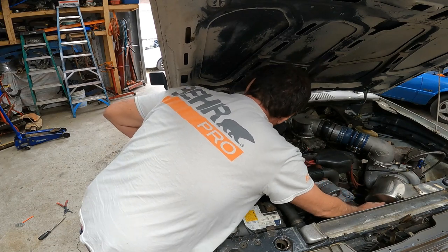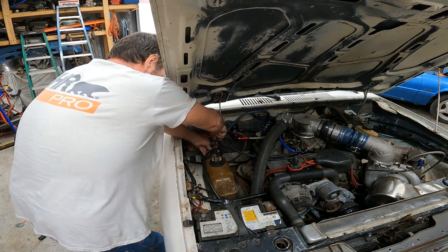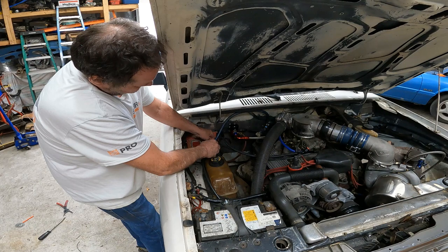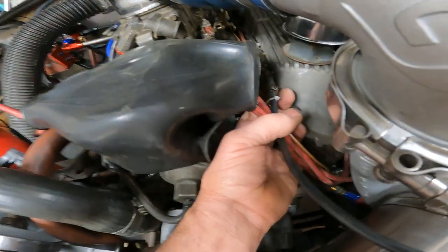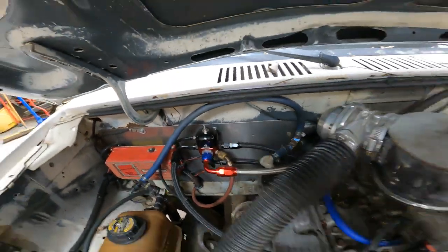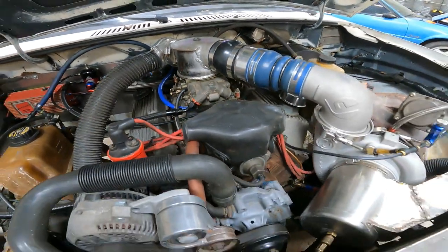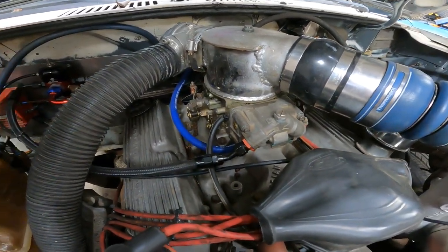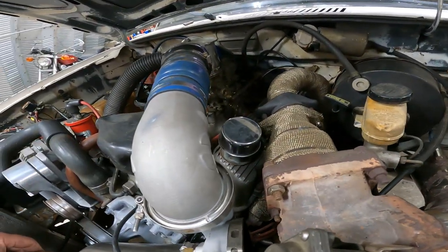Let's take a look at that one. Last time I took it out, this T right there was leaking — wasn't getting any signal to the pressure regulator. So it was running out of gas every time it hit some boost until the carburetors sucked dry. You let off and get the fuel back again and it was alright, until you stomped it again. Lack of fuel — basically like running out of gas. But I fixed that.